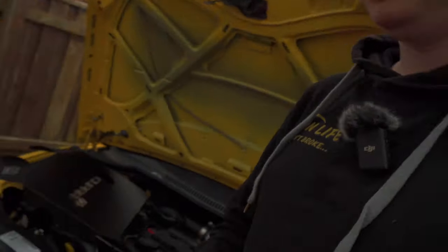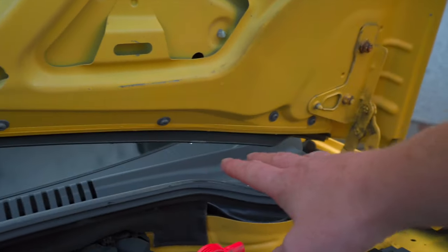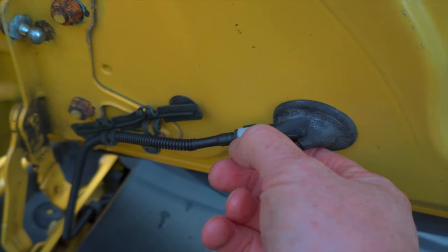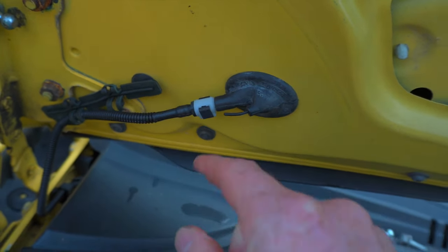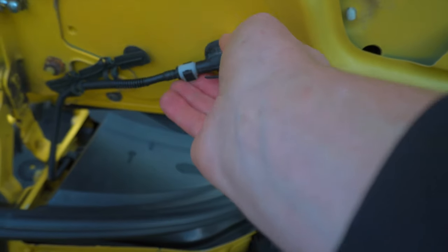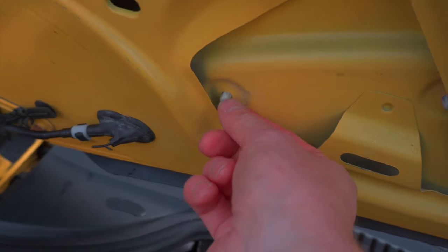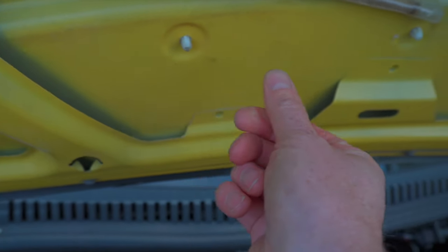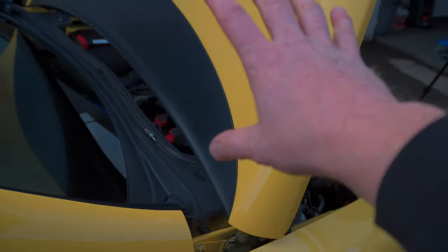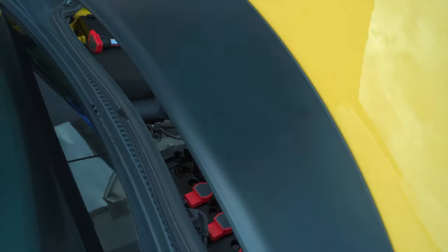I'll now show you how I fixed mine long term. First, remove the 10 bolts in the back of the bonnet that hold the plastic panel in place. Then disconnect the plastic tab off the washer hose, separating it from the car. Squeeze the grommet and push it up through the gap. You can also squeeze the plastic clips and push them upward through the bonnet. Then from the top side with the bonnet laid flat, gently prise up the whole panel and the clips will all come undone.